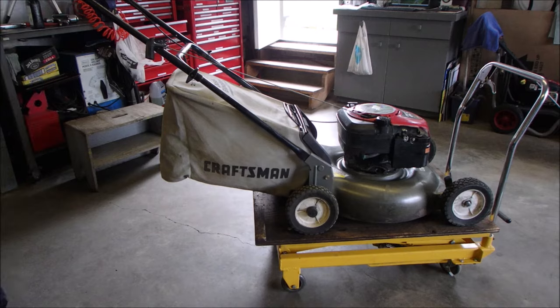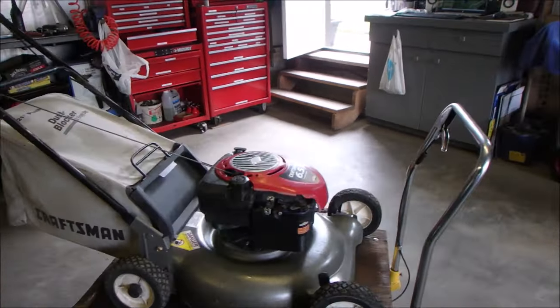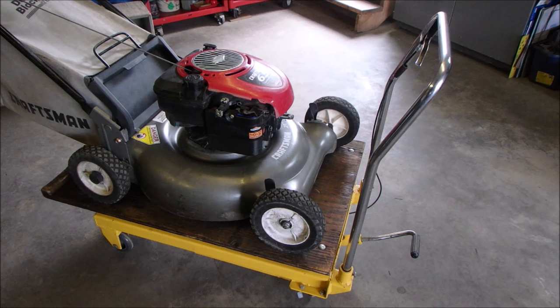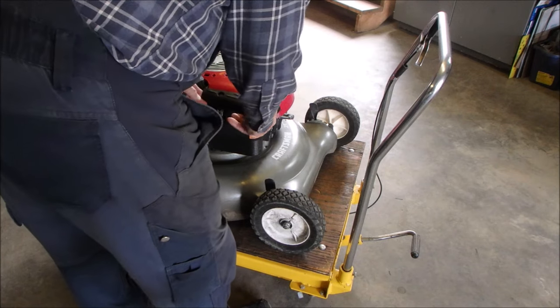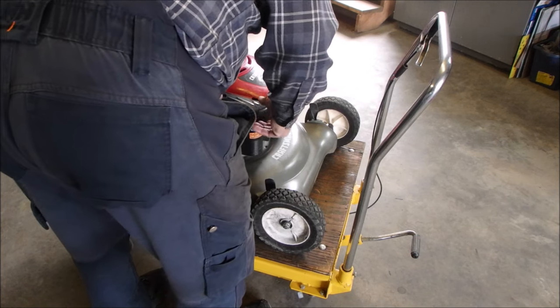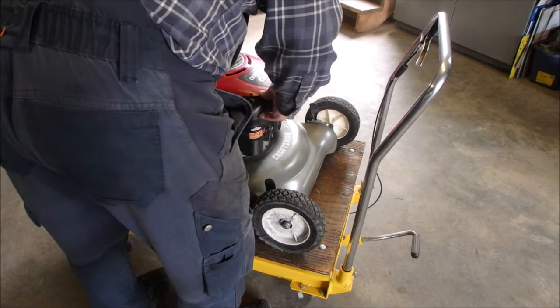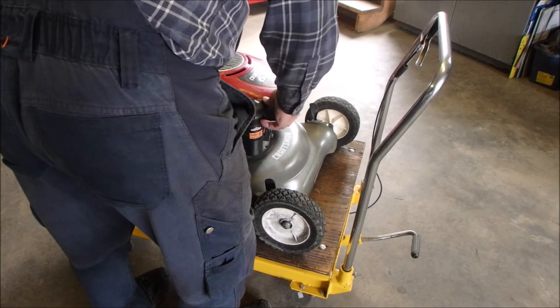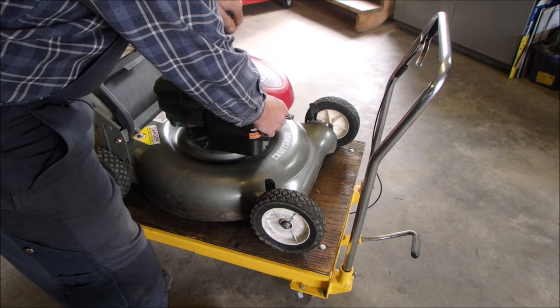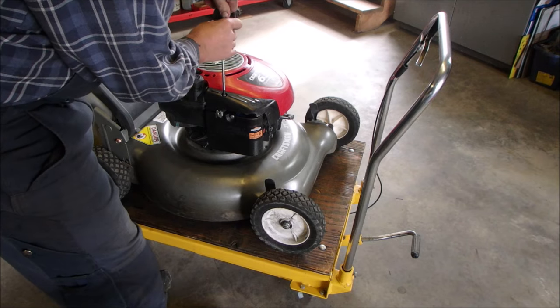At the end. Are you guys still watching this or are you not? Yes, you are. Good. So right at the end, I was setting the RPM, 3,120, which is great for a 20-year-old mower. Don't let that disturb you. I set them a little low. Even the Hondas I set a little bit low. Not every engine has to run at its 100% maximum, right? Almost at there, though. Much easier to do when it's not vibrating.